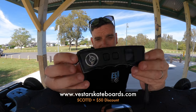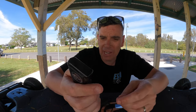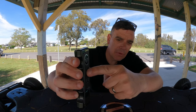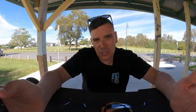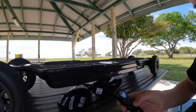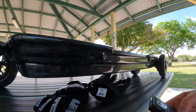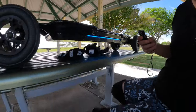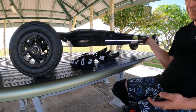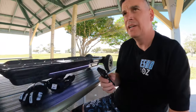Let's talk about the remote control - this is what they call their magazine style. As you can see it looks like a magazine you'd put in the bottom of some sort of machine gun. It's really comfortable: thumb goes on the wheel, forward to go, back to brake. You've got two buttons and your power button at the top. Hold that for a few seconds, the V logo comes up and it turns on. On the screen you can see all the information you need: the board battery, the remote battery, what direction the board's going, what speed mode you're in, what brake mode you're in, odometer - all that sort of stuff. So it's a very basic, simple, effective remote control. It also has lighting control - if you hold down the S button for a couple of seconds, your lighting turns on. As soon as you accelerate, after a while it'll settle and go blue.